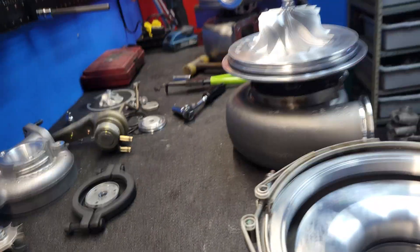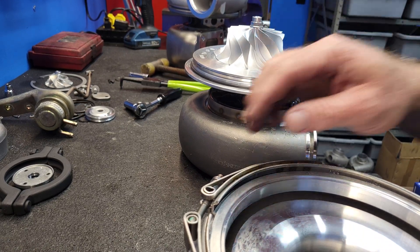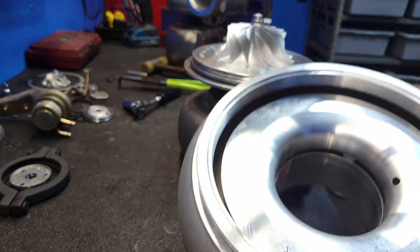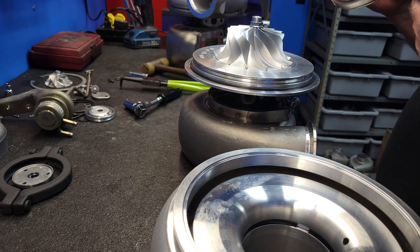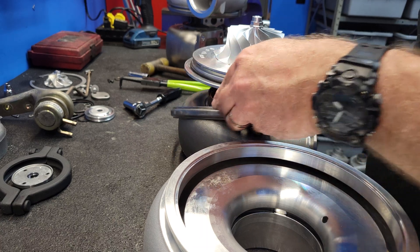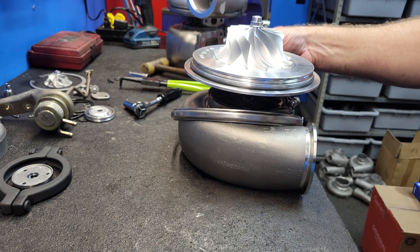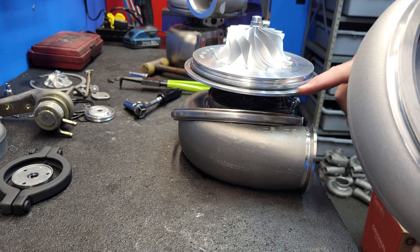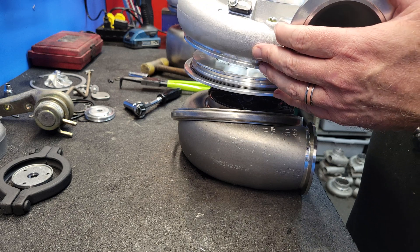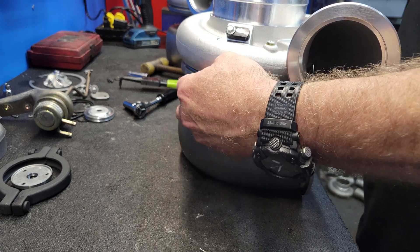Compressor side again. These turbos are very sensitive — the blades are extremely thin. You've got a ported shroud slot, it's very generous in these guys. What you want is to make sure that when you put this on, everything on the mating surface is clean. Spotlessly clean — no dings, no dents. If somebody pried it with a screwdriver, take a file and clean it down. This housing has to go on straight. That ported shroud slot will grab one of those blades on the compressor wheel, and that will be a bad day as well.